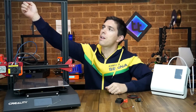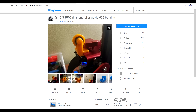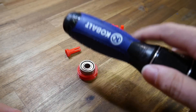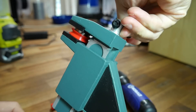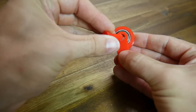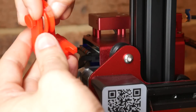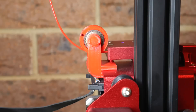Next, we're going to turn our attention to the sub-optimal filament path, which comes down from the top on a very steep angle. On my first long print, I noticed excessive filament dust buildup from this very problem. Luke Hatfield, who gives so much to the community, has a great design on Thingiverse which I highly recommend. It uses a 608 ZZ bearing, which you can find in a fidget spinner or a skateboard. I turned to a little vice and used it to press the bearing in, which was very effective in getting it aligned. Part of the reason I like this design is that it requires no other hardware — it's got a nice press-fit pin that clicks into place, and when you mount it to the printer there's a little notch to help you line it up. Mine went on with a satisfying click, and it didn't make loading filament any harder than before.